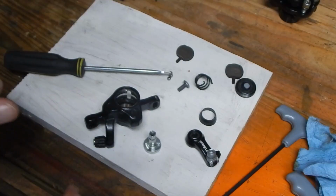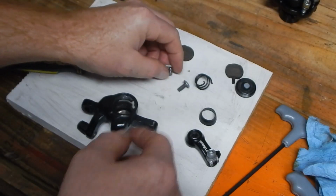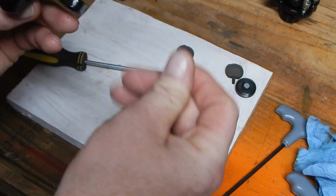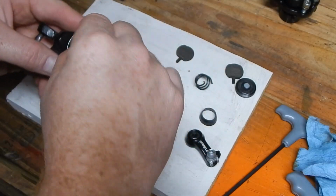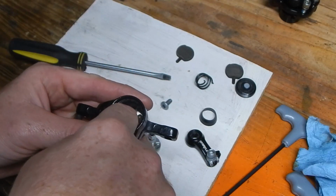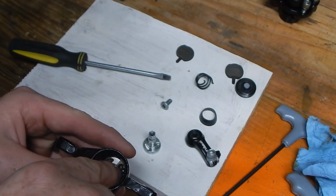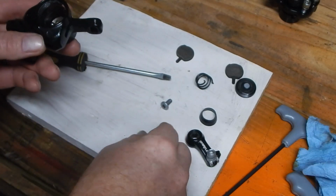But once that's done, you put a little bit of grease down here. You can actually put it on the ball bearings themselves if you want to, and then drop them down in. You can also just roll it down the side of the caliper and then kind of push them into place. So you just get them in there, move this one around, and get it to drop down into that ramp. So there. The 3 ball bearings back down in the 3 ramps.